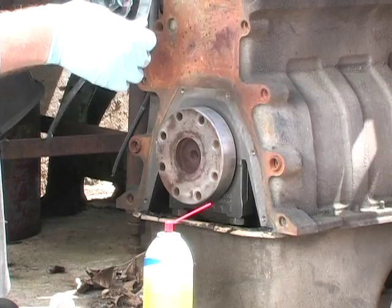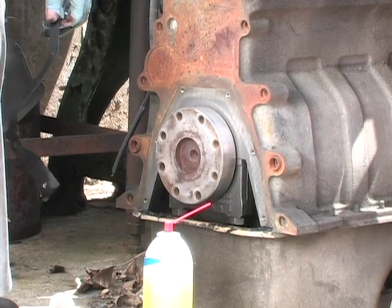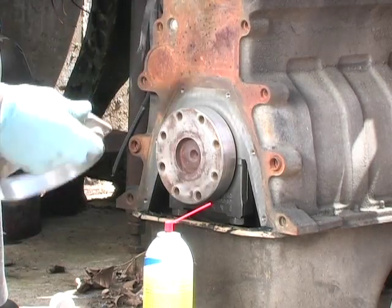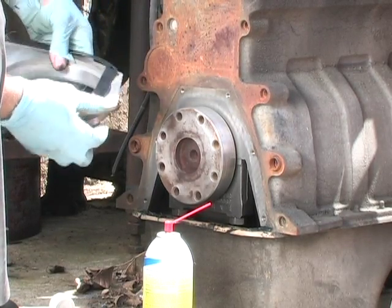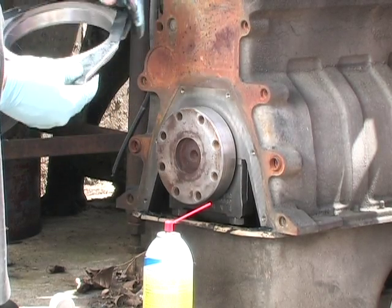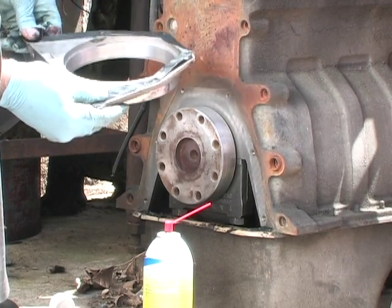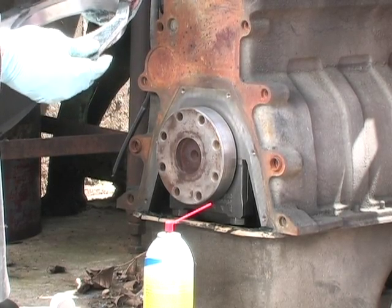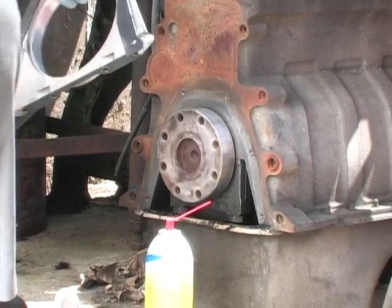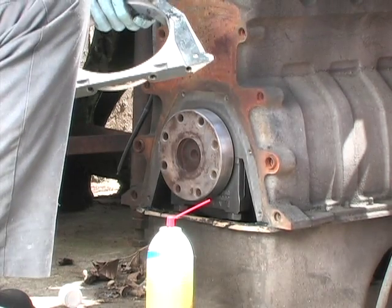What we're going to do now is install the seal cover. The reason why we're doing it without the seal is because there's no alignment pins anywhere on this. It just kind of says, well, wherever the bolt holes are is wherever it's going to land. Not my idea of a good plan. Some of these things I've seen as much as 90 thousandths off. So I'm going to stick my gasket on here, like so. Make sure the holes kind of line up. Put a little right there.